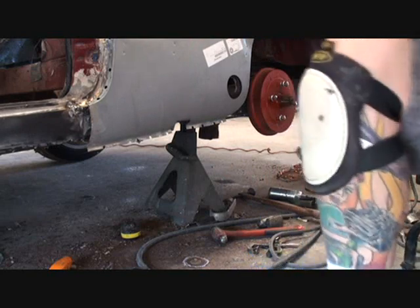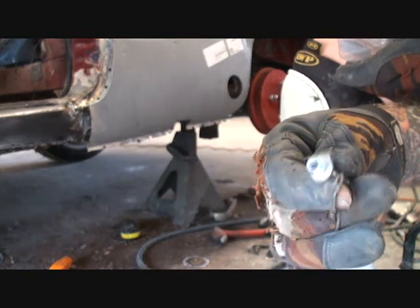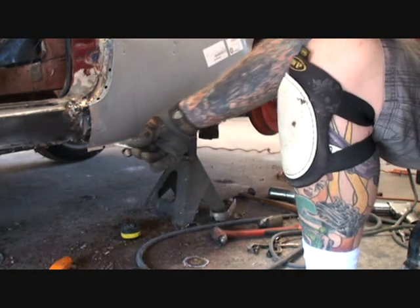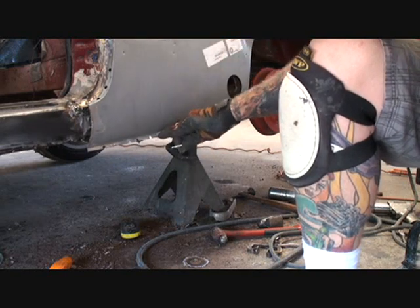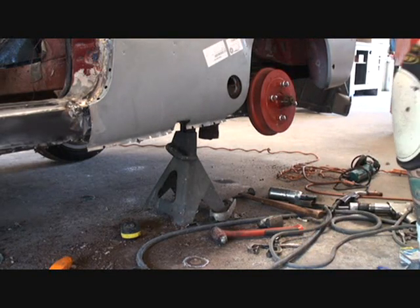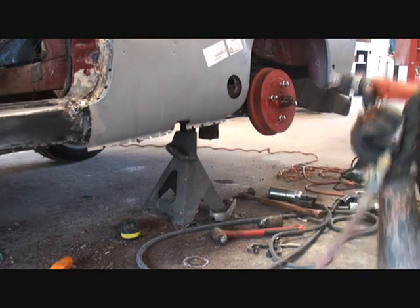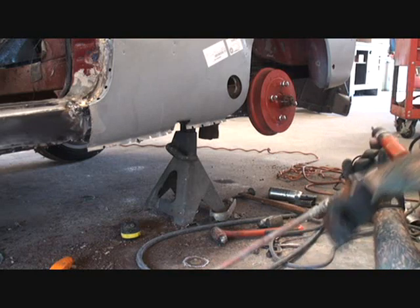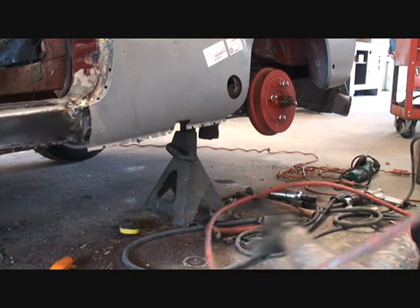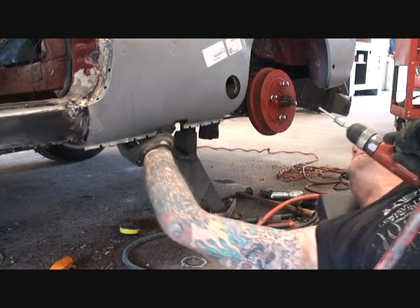What I'm going to attempt to do — I've got some two-inch long self-tapping number 12 screws. I've got four of them, so I've got a good chance of doing it the right way. I'm going to screw these into my lower quarter panel and then into the bottom flange where it welds together, and hopefully that's going to suck it all together and make a real nice tight fit. The problem with it not fitting right — there's actually three reasons. First, it's an aftermarket panel.